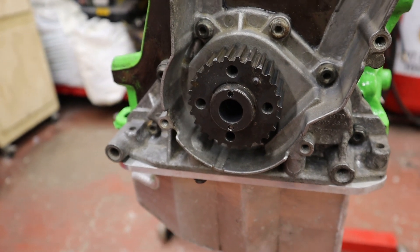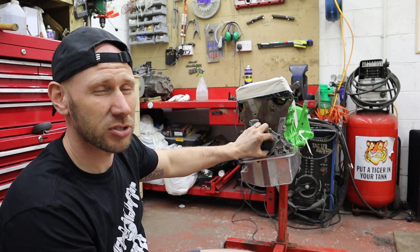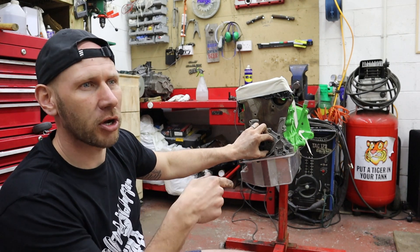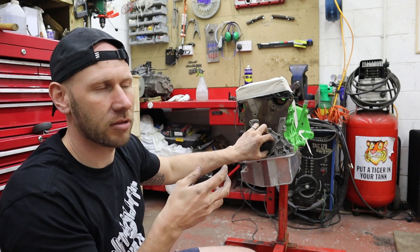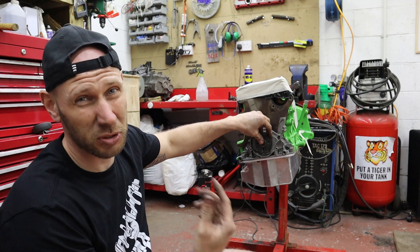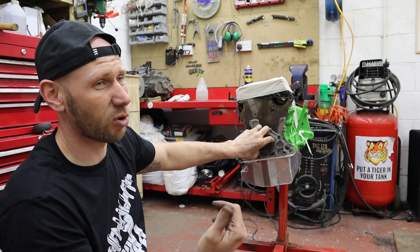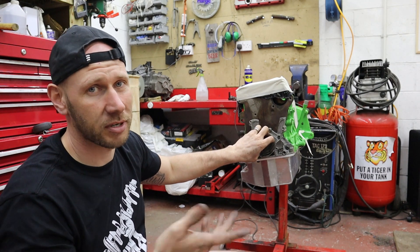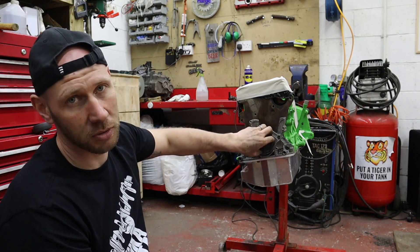That's the pulley pinned onto the crank now. I've used two pins — some people just use one, and that's probably good enough to be honest. But the whole point is you're adding that extra bit of shear strength from the surface area you're putting in through the pins. I'll just put two in — I've done it before and this is the way I'm doing it now as well. Use one, use two, use 4mm, use 5mm — it's up to you. I use 4mm, 30mm pins, and I put two in.